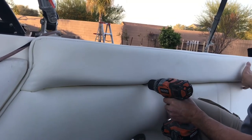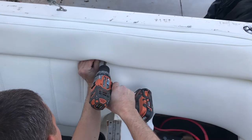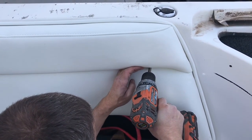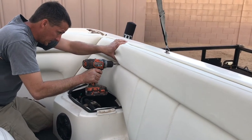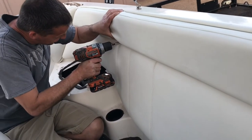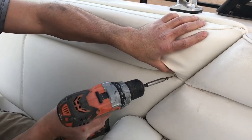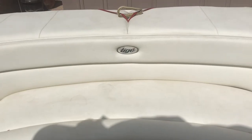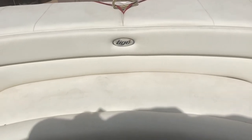I bought a whole new box of screws for six or seven bucks — Torx instead of Phillips because they have a less likely chance of stripping out, and stainless steel because it's the most water-resistant option. Another thing I learned: don't pre-start screws in the panel before putting it into place — that's a waste of time. Once someone holds it up and you get the first screw started, the rest will push right through the plastic and fiberglass. Also, make sure you set all panels in place first to confirm they fit — after doing two side panels I had to readjust one because the back seat wouldn't fit.